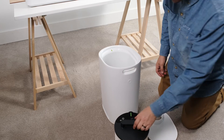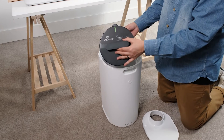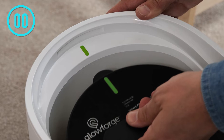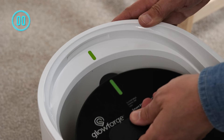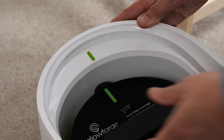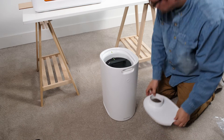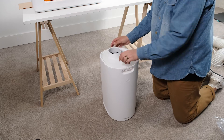Next, let's remove the cartridge from the plastic bag and put the cartridge back into the filter, lining up the green mark on the filter case. It'll slide into the notch at the bottom. And to make sure it's inserted correctly, try to turn the cartridge using the handle — it should stay firmly in place. Finally, put the lid back on the filter so the notch on the lid lines up and the lid fits snugly in place.